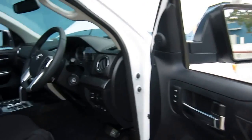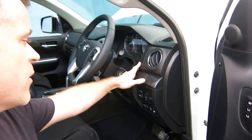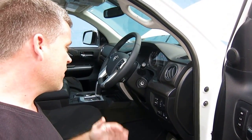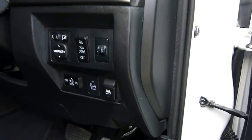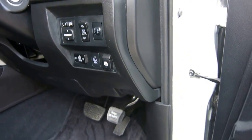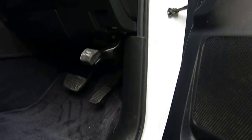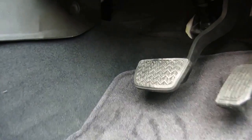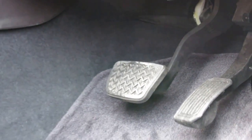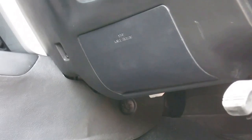On the driver's side here, everything's been remodelled. We haven't used the original surround - we make a new surround because it is handed from one side to the other side, so it looks symmetrical but isn't. We've maintained the original control panels, which are all original and unchanged. We've moved the brake pedal and park brake pedal from the left-hand side across to the right-hand side, as you can see located here. All of our carpets run a stitch all the way around for the modified carpet - the manufacturer just leaves it as a cut edge, but we actually put a nice sewn edge onto it. The vehicle is fitted with knee airbags, both left and right. They're retained and input into the new dash itself, untouched and located in the mirror position.